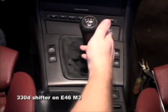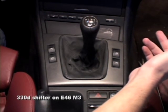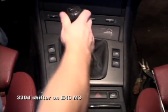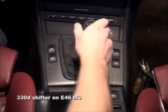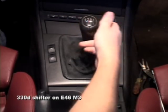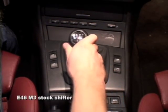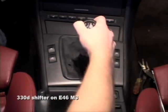Pretty much less than an hour, we've changed out the regular E46 M3 shifter to a 330 diesel shifter. Let's check out the throws — this is the first time I'm using it. Not too bad. You guys can see here that there's a pretty big difference, especially going second gear, fourth gear, and sixth gear. The throw is a lot shorter.